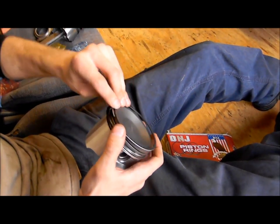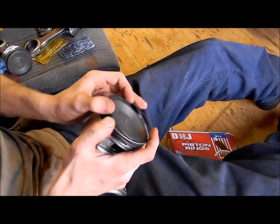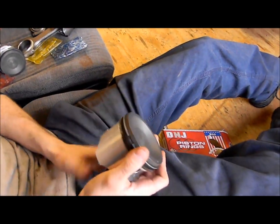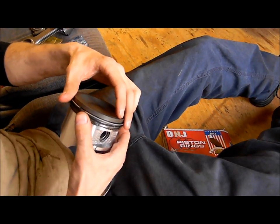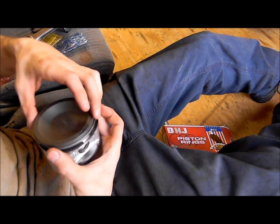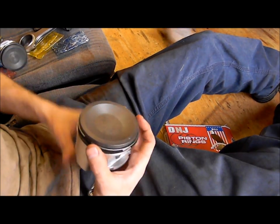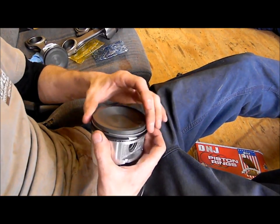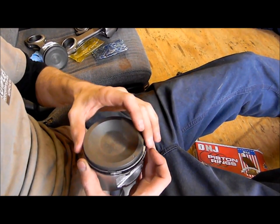This is the drivability of your engine — if the crank is hung up, it will not run. When you put the rings in the bore, the gaps have to be 45-degree offset. You don't want them lined up because that would create a straight line of oil not being scraped off the cylinder.